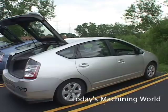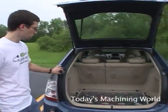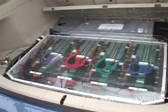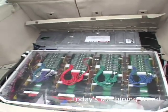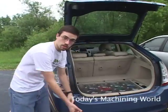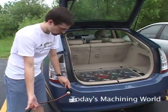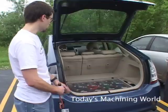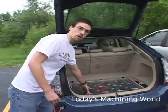Basically what we did is we took a stock Toyota Prius, which already gets about 50 miles per gallon, and we added an extra battery pack here. The idea is that this extra battery pack allows us to get about 20 extra miles of pure electric mode, and there's a plug which hooks up to a charger that charges the batteries while you're not using it. So this extra battery pack supplements the original Prius battery.